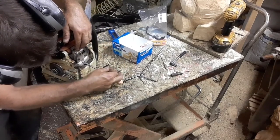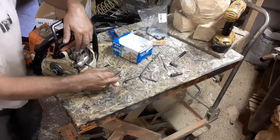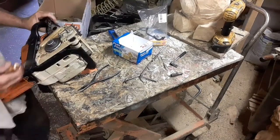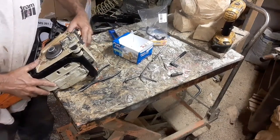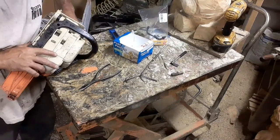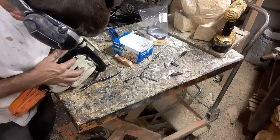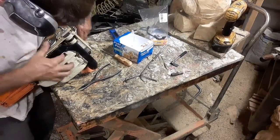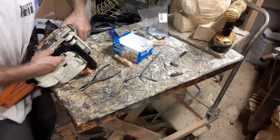So, I was right. I don't know if you see that, but I see it. This is a warning that maybe it's time to not run this saw. But before we get all crazy taking the entire saw apart, we need to determine where that looseness is coming from. So I put my finger in. This is the bottom of the motor in this hole. I put my finger in there and try to put it against the white case and see if I feel a difference.